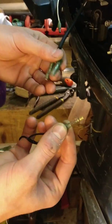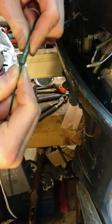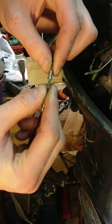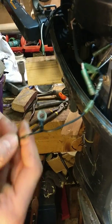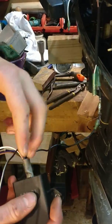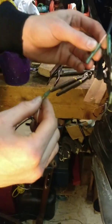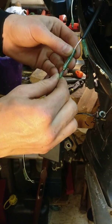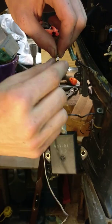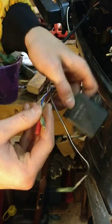So: black earth ground lead to the pulsar coil. These clips make a noticeable click noise when they're plugged in, and you've got to make sure they're properly connected otherwise they will not transmit electricity properly. Next, for the pulsar coil there is a red and white wire — match that to the red and white wire on the pulsar coil. Clip it in, make sure it's properly clipped. If it's slightly loose, give it a squeeze with pliers to make sure it's tight.